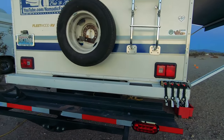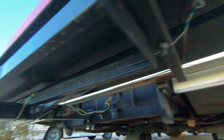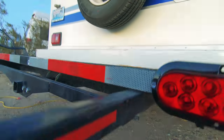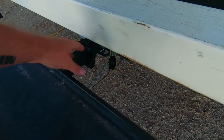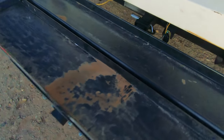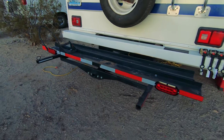Let me show you the wiring — I just looped everything underneath and used zip ties. There's a bundle going over there, and there is a release right there in case I have to take the hitch out for some reason — that's why I put in the four-pin flat connector. You can see wires in here but they're all tucked away and hidden, so I think it looks pretty clean. Pretty happy with that project.